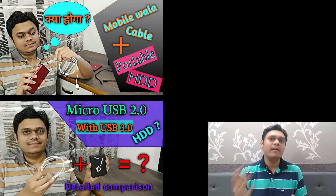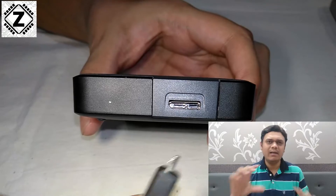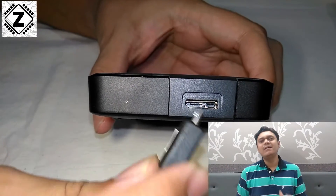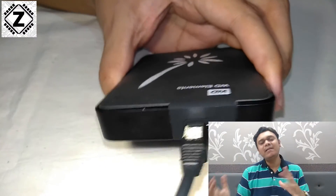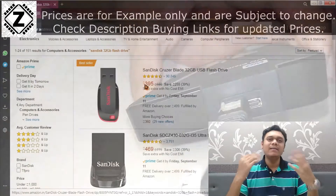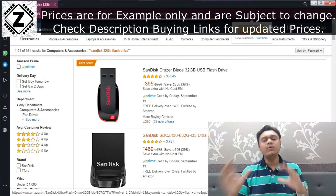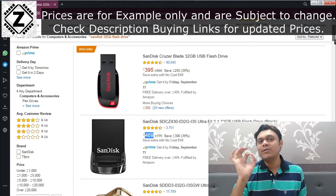We also tested this concept with hard drives. I used an Android mobile phone style cable on those hard drives, and what that cable actually did is revert those hard drives back to the older USB 2.0 standard, which really slowed them down. This is the same kind of behavior we are seeing here.